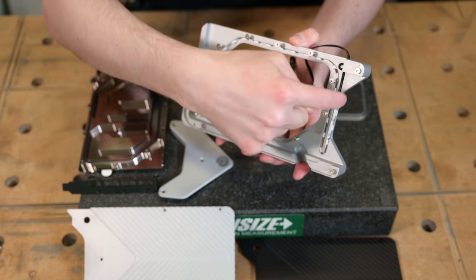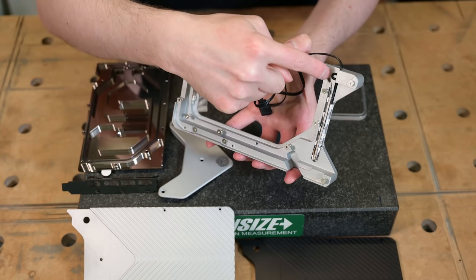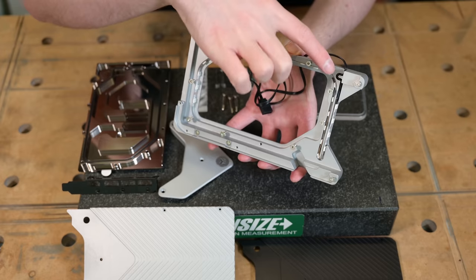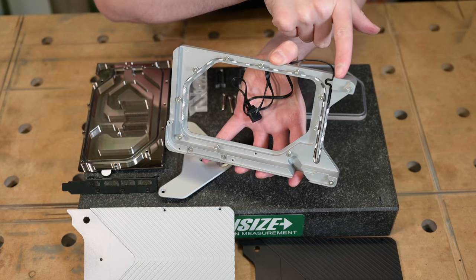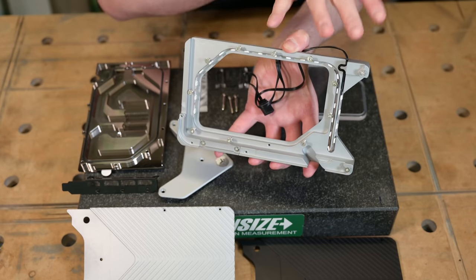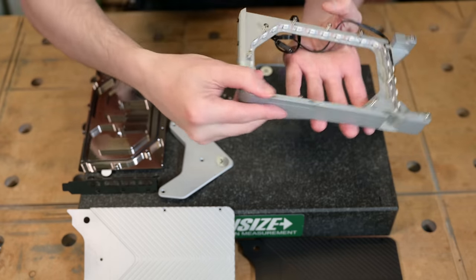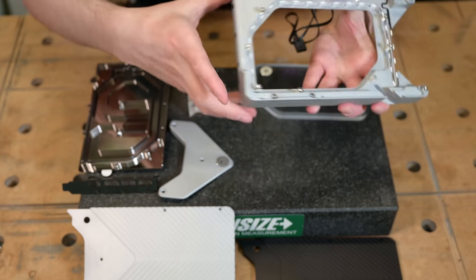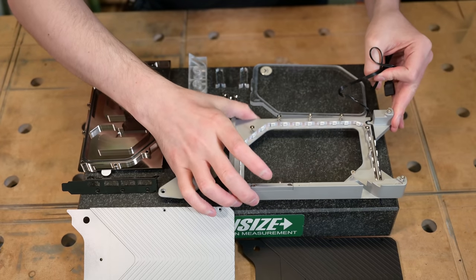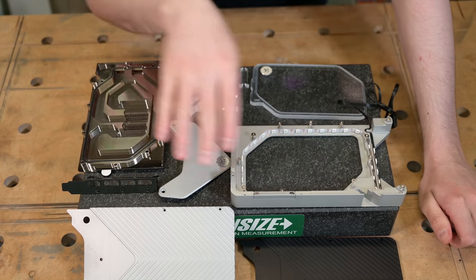We've also got this large LED contour, and that requires a very thin tool with a very long neck and potentially even a different shaped sort of geometry just to get past this part over here. That's a big job. There's an awful lot to do in there. And then also we have to consider we've got engraving on this side, we've got threads on this side. So depending on how many axes the machine that made this has, this could be an awful lot of operations. That's quite interesting. And then on top of that, we have all the finishings.